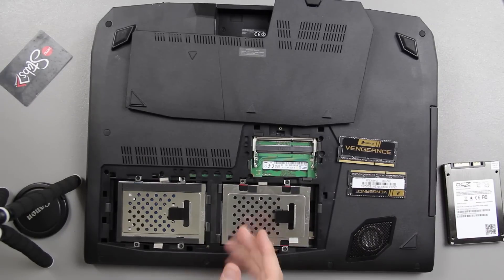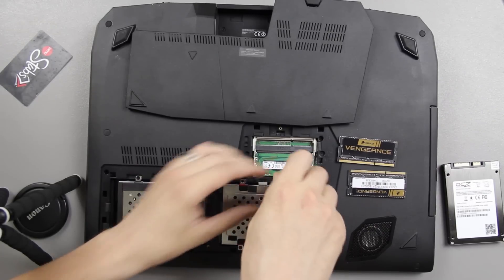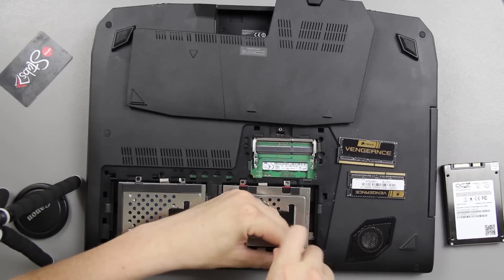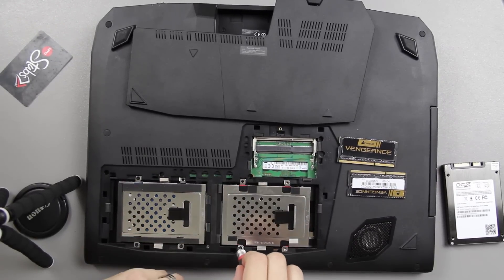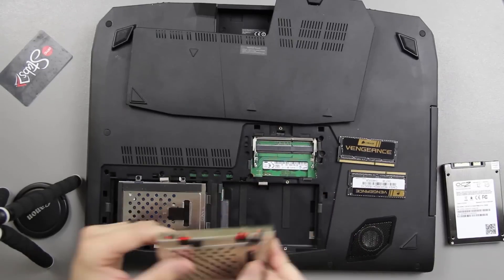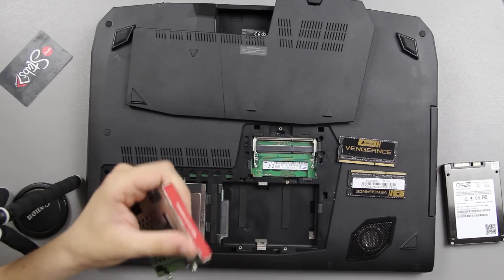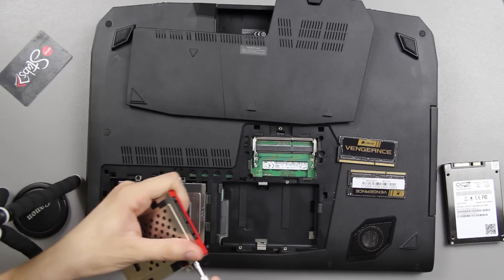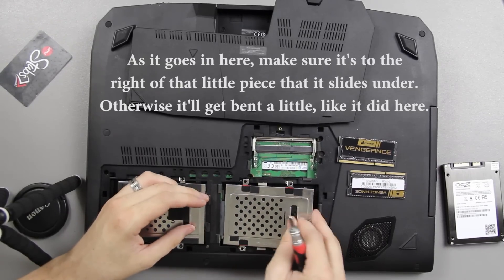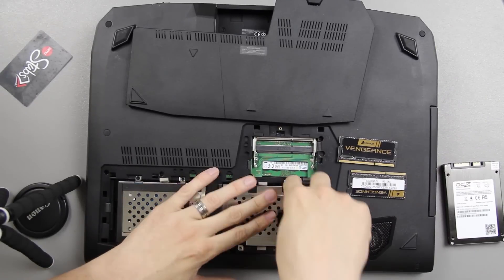Sometimes that gets a little bit tricky, especially when you're trying to clone a bigger drive to a smaller drive. It's not as hard cloning a smaller drive to a bigger drive, because when you clone it you'll only show 120 gigs used when you actually have a 480 gig — you can expand that and make it bigger. But when going from a bigger SSD to a smaller one, you'll need to first delete any files that are really big, move them to an external hard drive, then back up your SSD as partitions to an image and restore it. I always end up running the Windows 7 or Windows 8 recovery helper thing that fixes it and lets me boot.